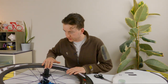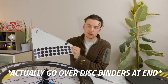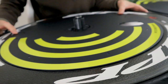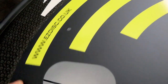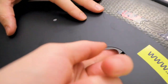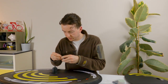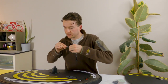We've got the protection on now — there's one bit left over just in case you make a mess, and I assume these are nipple protectors for the nipples on the rim. Now that we have the protection in place, the next step is putting the disc cover onto the wheel. The first thing to make sure of is that the hole lines up with the valve — you need that obviously lined up. Once you've lined the valve up and the disc is in the right placement centrally, you hold it in place using a little bit of electrical tape so it doesn't move during the next step.